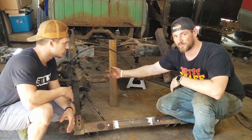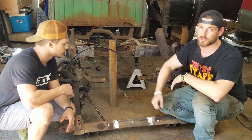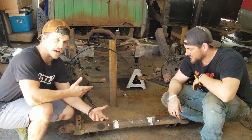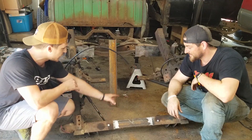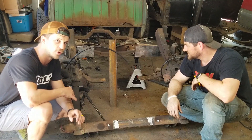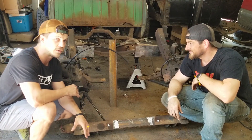Nobody sold a piece of metal we could sleeve the crossmember with, so we're going to have to take it off when we're done assembling and build one from scratch. The metal we used for the center is actually double the thickness of what the factory used, so we feel really confident it's going to be really strong. Once we get this temporarily boxed, it will go onto the car and we will officially have our new width — 13 inches wider than factory.